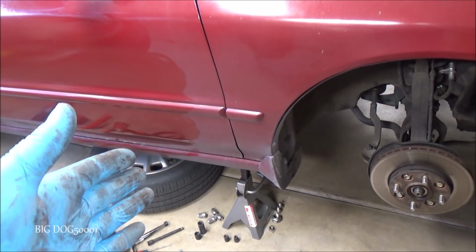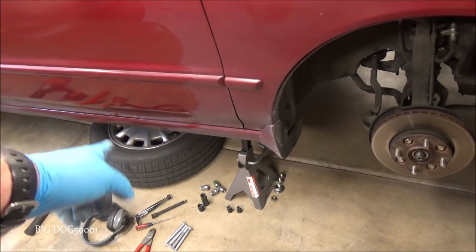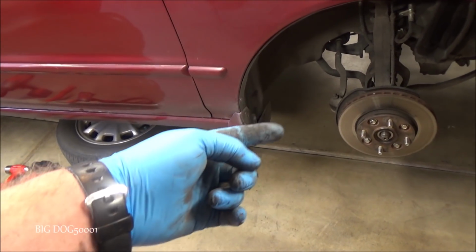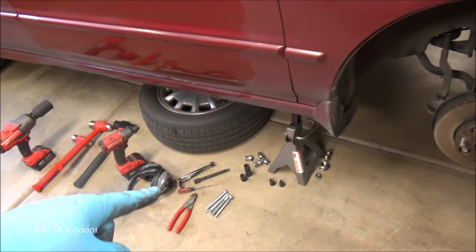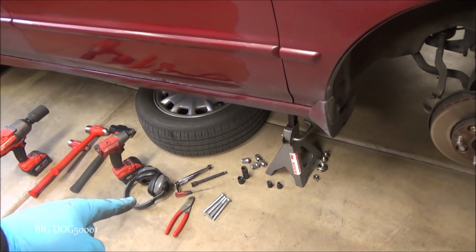And I'm just going to take a break to talk about safety for a second. As you can see, I have the rims underneath the vehicle, not only on this side but on the other side. That's a secondary protection in case for some reason my jack stand failed. Another protection, I could leave the jack in place. And if I'm hammering on something, I'm using eye protection. And especially in the case of an air hammer, I'm going to use ear protection. Very important.